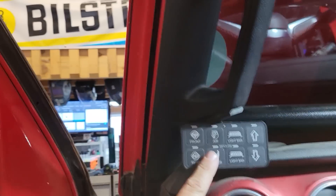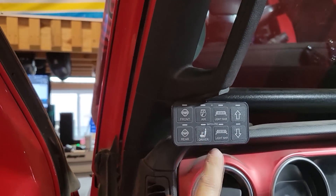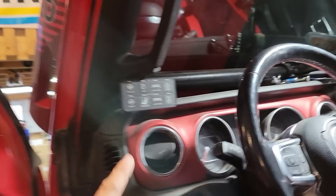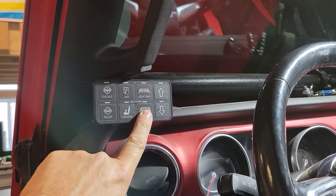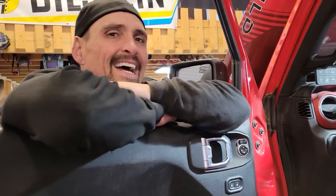Now we have our switches here for the heaters. We want it on ignition — they pull about 20 amps between the pair and I didn't want to wire in a relay. Then I remembered we have a Switch Pros and I only have three of eight slots used, so that's what we did. The Switch Pros is only used for my front and rear lockers and air, so all the rest were open. Now we just hit that and it turns on only when the vehicle's on — I was worried Brittany would leave her seat heater on and kill the battery. Also notice those light bars and those outputs are going to be for something we'll talk about in the next video.